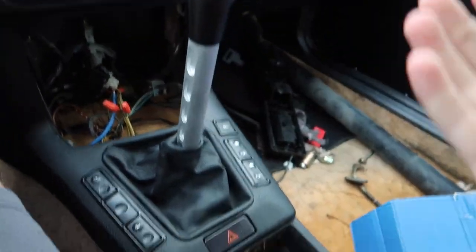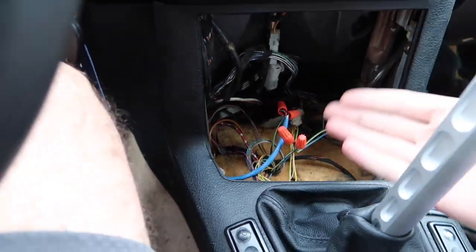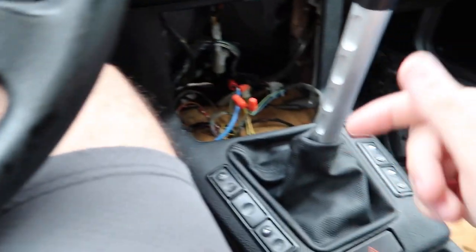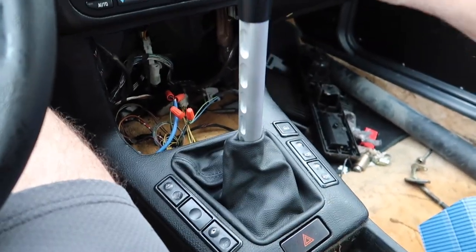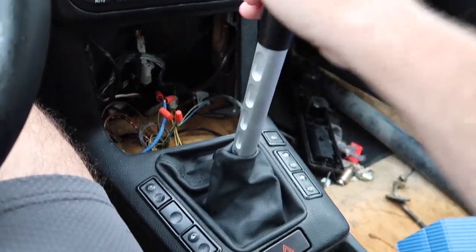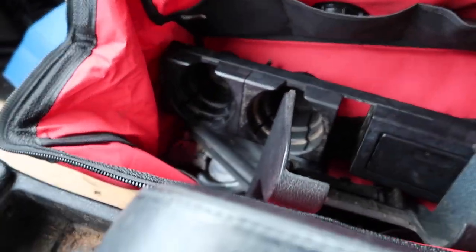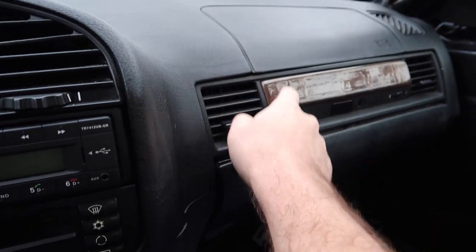We still have a bunch of things to work on. Blake did all the wiring for the lights so we have everything working correctly. We wired the reverse lights to the transmission so they come on in reverse. We also set it up so you need to press the clutch pedal to start the car, which I wanted because my e-brake doesn't currently work and I need the car to be in gear on a hill. We have so many new parts — new speaker grills, new bulbs, new trim pieces for the rear, a brand new e-brake, and a new black piece to replace the lighter surround so it matches the dash.